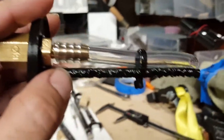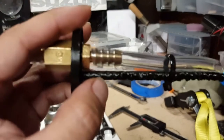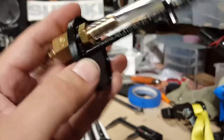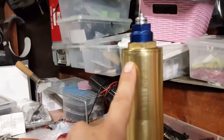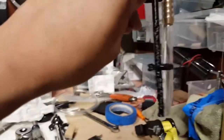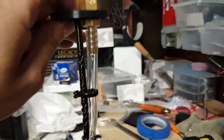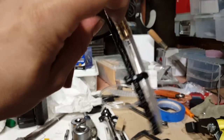There are many discussion topics on the forum that say go 120. I've seen a couple of videos that say go 130 millimeters. So you're roughly measuring from the top of this, which is the top of this, and going up or down, however you see fit to see it. 100 millimeters is what the service manual says your measuring tool needs to be.